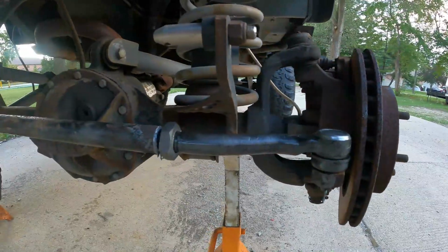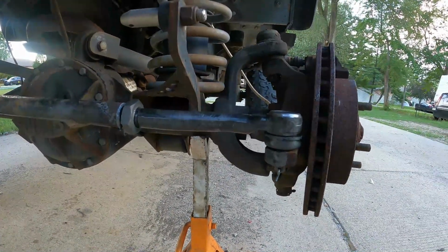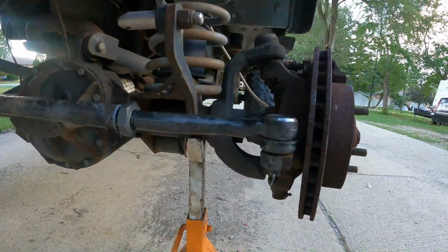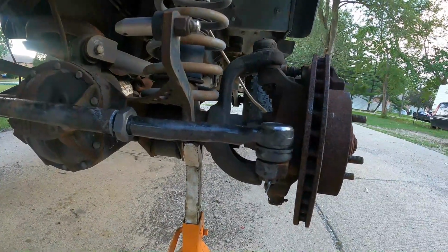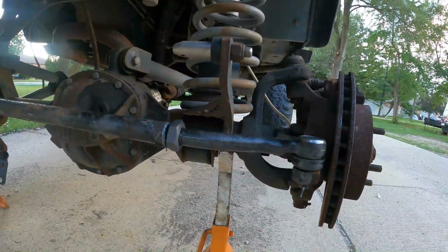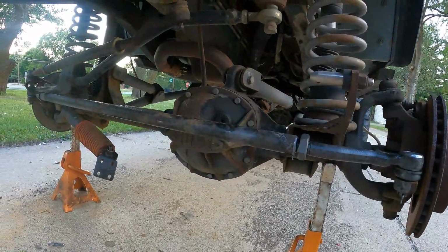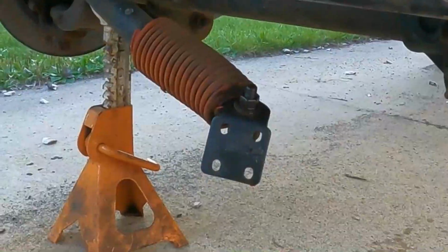All right, I went ahead and installed that other one with just the nut on the bottom the way I think it's supposed to be installed. I don't think it can actually pull through there. It has about 50 thousandths per edge. So I'm gonna go ahead and get the tires on, set the steering, and hopefully take it for a test drive after I fix that.